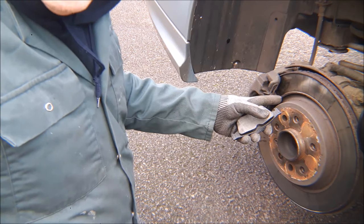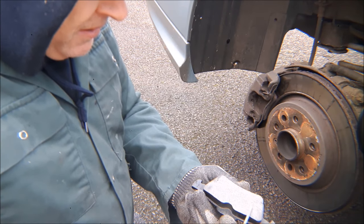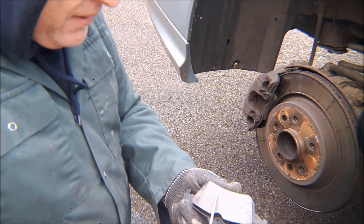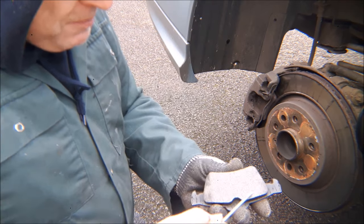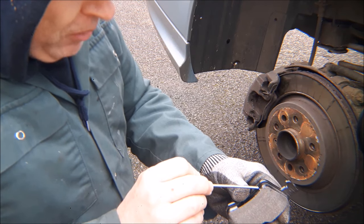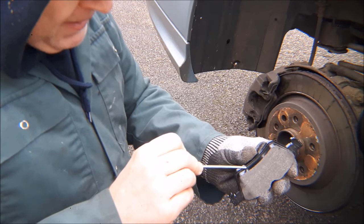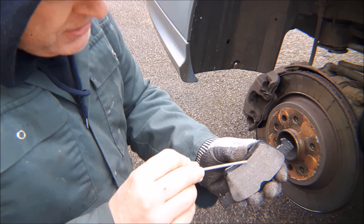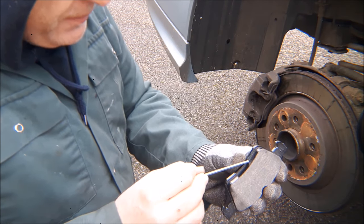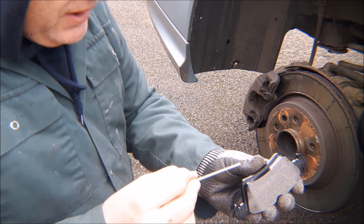You might think three millimeters means there's loads of material left, but the reason for changing at three millimeters is that the friction material has a certain mixture which has metallic particles and resin binding it together. The backing plate is steel, and the brake pad material is adhered to it. In order for that bond to be as strong as possible, the back side of the pad is manufactured with less metallic particles than the braking face — the extra resin produces a stronger bond to the backing plate.